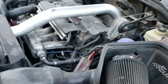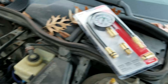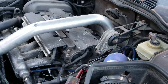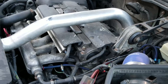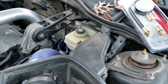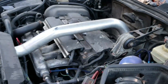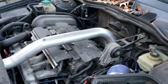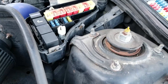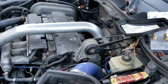About to hit Byron's V70R with a compression test. Had to buy a gauge — I've got one in Vegas I think, but I tried to borrow one from two different places and neither had a loaner tool, so I bought one. Warming the engine up a little bit, about to pull the plugs, disconnect the fuel and spark by pulling a fuse, and do this compression test. Let me get this cover off and get ready.